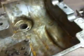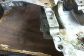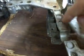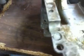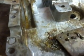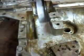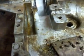So since I've got the neoprene washers, I could convert this over to gear oil if I wanted to, and just take some liquid gasket sealer, run it along the edge here, and then put some in here in the bushings to seal off the bushings too, so that nothing comes out from there. It shouldn't, because it should be compressed with the case, but hey, extra measure. So I could convert this thing over to gear oil, which in the future I wouldn't have to worry about the availability of bentonite grease anymore.